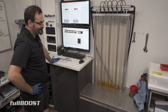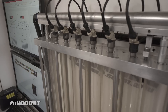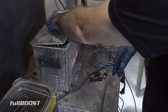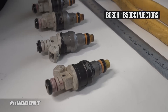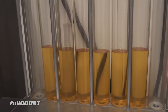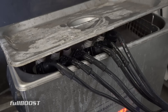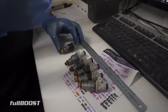So you're just giving the white top injectors a quick flush? Yep — just give them a quick flush, remove any debris and we'll test each one individually. So this is our second clean. They've come out, we've let them settle down in terms of temperature back to equilibrium. I ran them up once and was getting around mid-sixes, so I've done a back-to-back test and they're sitting at around about 7% — so they haven't improved at all. They've actually deteriorated even more. After the first clean they were 4.9% and now they're up to 7%, so I'm going to call a spade a spade — these injectors are filthy and they're not going to get any better.